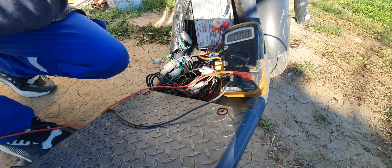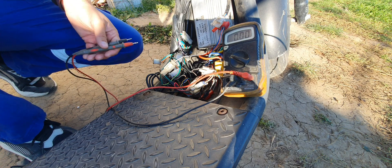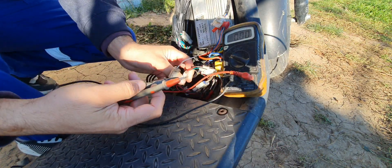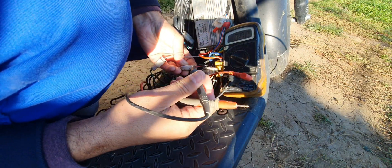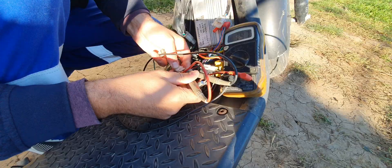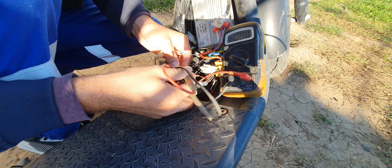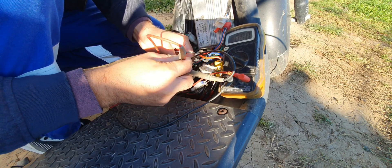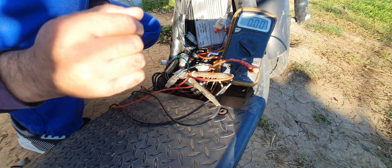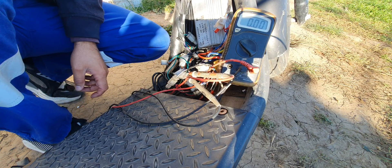I'm hoping you can see what I'm doing here. Connect the battery, it makes a sparkling sound. Started the scooter, accelerating and nothing happens. Let's measure the voltage — it should be around 5 volts between the black and the red, and it is 4.97. Now black and green should be around 0.8, that's where it starts from, and when you accelerate that should rise. We've got nothing — no voltage coming out of it, so that leads me to believe we have a broken wire somewhere.